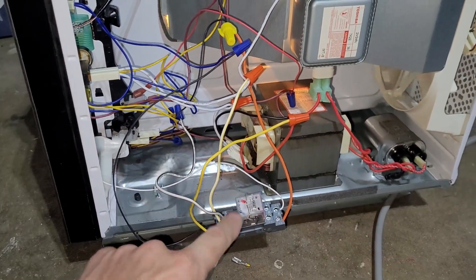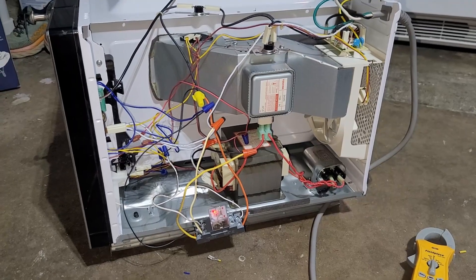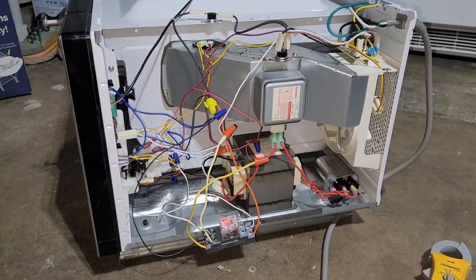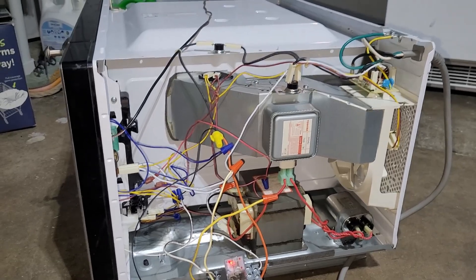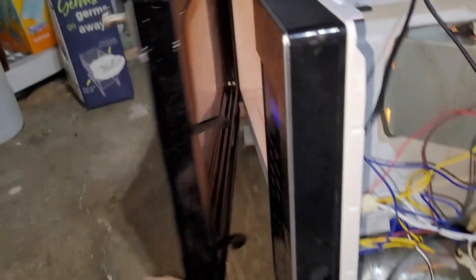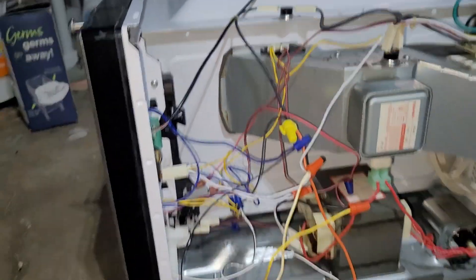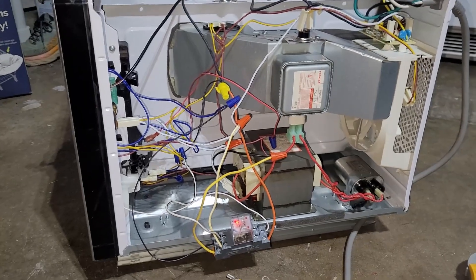All of the safeties work off of that one door switch, which triggers a relay to handle the other door switches. That's why it's nice to know how to use relays — single pole double throw, double pole double throw — tools at your disposal. For me, never having worked on a microwave before, doing a dumb thing and essentially breaking it, if you know how to use a relay you can just put one in and fix your microwave.